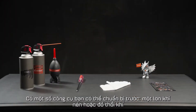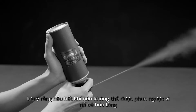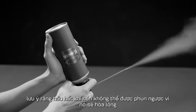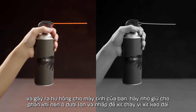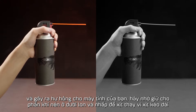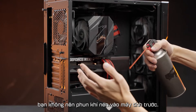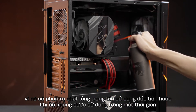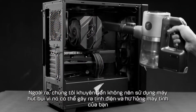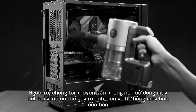There are some tools you can prepare. First, a can of compressed air or an air blower. Note that most compressed air cans cannot be sprayed upside down since it will liquefy and cause damage to your PC. Remember to keep the compressed air's bottom down and use little sharp bursts instead of long bursts. It's recommended to spray the compressed air away from the PC first, since it will spray out liquid on the very first use or when it hasn't been used for a while. Also, we don't recommend using a vacuum cleaner because it may cause static electricity and damage your PC.